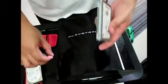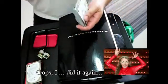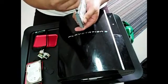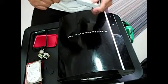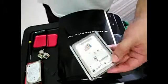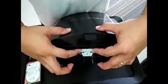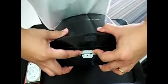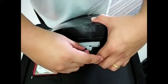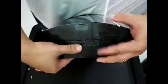First of all, don't forget the screws. All you have to do is put the screws in. For the sake of speed, I'm just going to put in one screw, but I highly recommend you put in all four, especially when you're moving your hard drive a lot and for safety. This is the reformatted laptop hard drive — 500 gigabytes. Lift it, make sure you slide it in gently into the bay, let the handle pop, make sure it's centered, fit it in really good, push it in, and make sure it's secured to the port inside. Get that blue screw in there and screw it back. Then place the flap — hole in first, push, then slide.